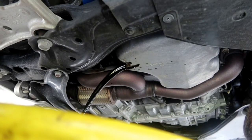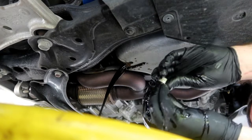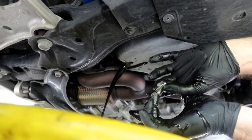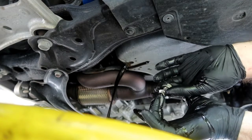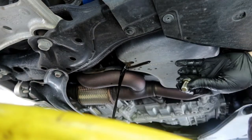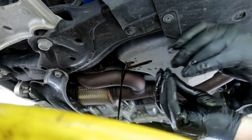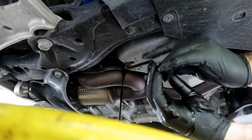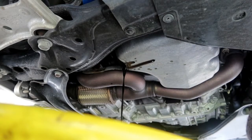Since the car was getting warmed up, obviously the oil is going to be hot to the touch, and it will splash. I'm going to take this old gasket off of there — yep — take that gasket off. It came with a brand new one. Put that on, set the plug aside, let that finish draining.